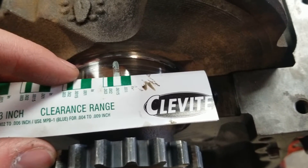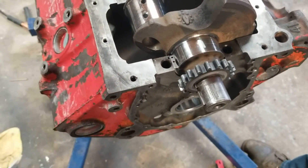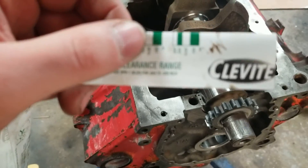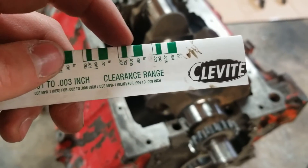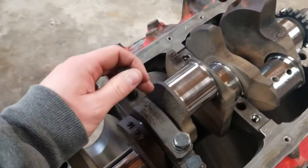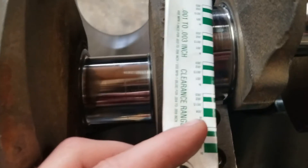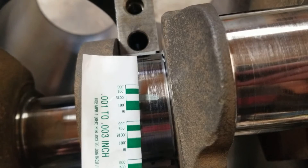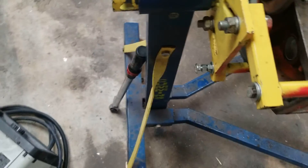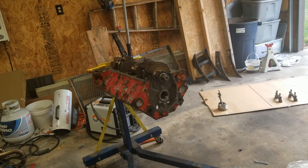I'm going to look at that one to see where it's at, and it looks to be pretty much right in between 0.002 and 0.0015, which is exactly where it's supposed to be. For the rods you want it on one of these two middle lines. This actually looks better than the rods because there's a little more clearance, which is probably better. As long as it's not smaller than 0.003 and definitely not as big as 0.001, anywhere in the middle two is fine. That looks fine. Let's check the middle one too — yep, definitely right about the same, right in the middle between 0.002 and 0.0015. We should be good. This is going to be it for bearing measuring. Coming up next, we're going to be doing rocker arm geometry, so stay tuned for that after we get the heads on.